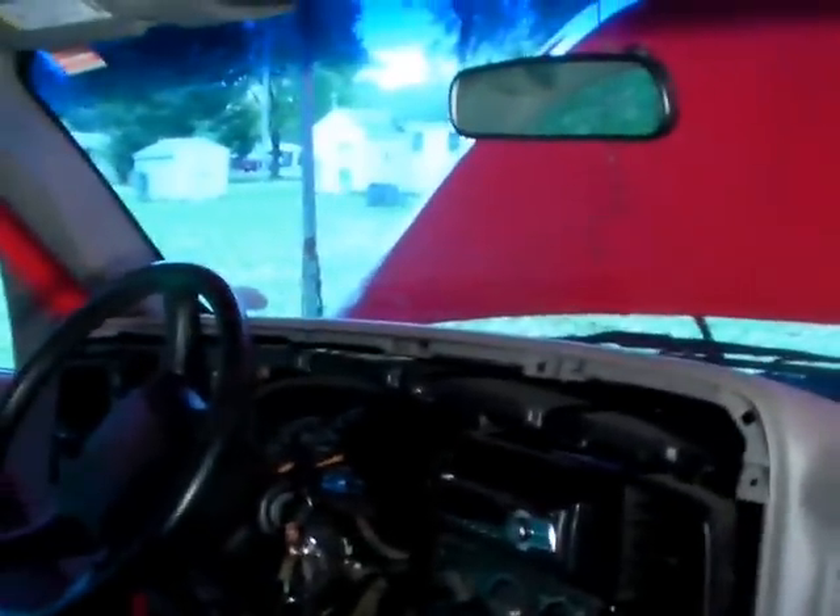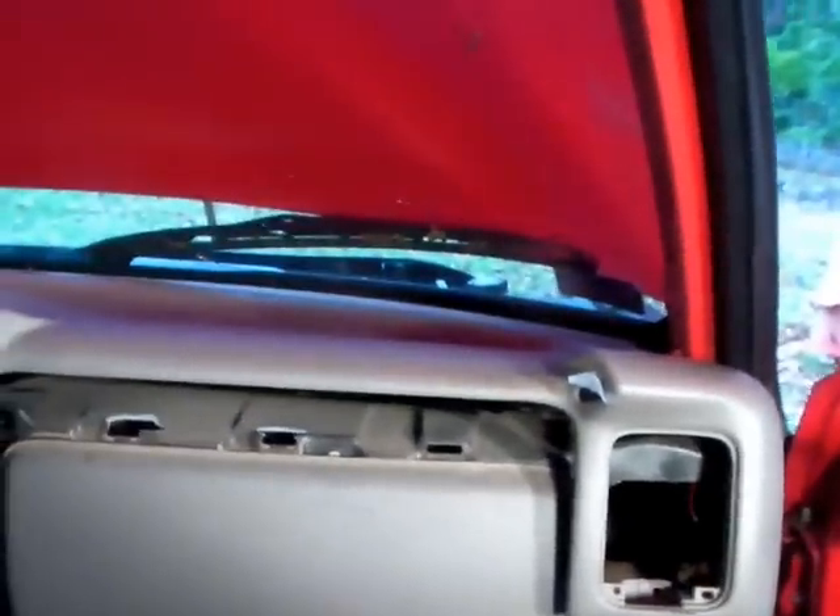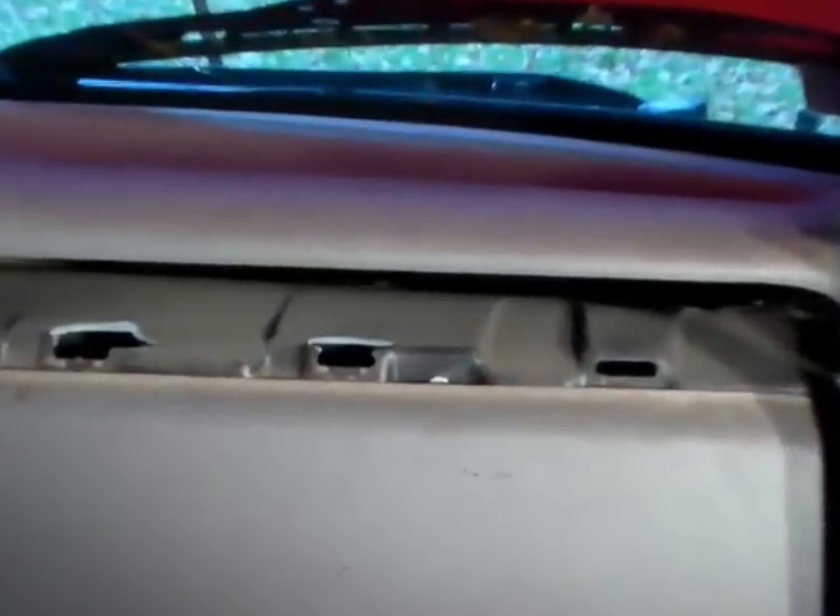After the grab handle, remove the post covers before you can pull the top of the dash out. I made the mistake of pulling it straight up and I broke some plastic on the clips — it should pull out towards you. The headlight sensor that comes up through the bottom of the dashboard cover is like a quarter turn and then it releases. You don't have to disconnect the wire.